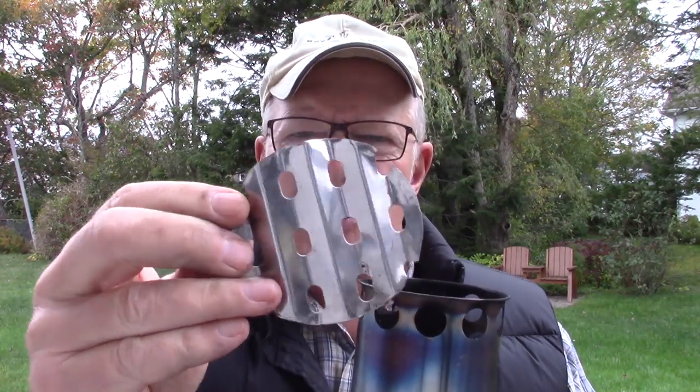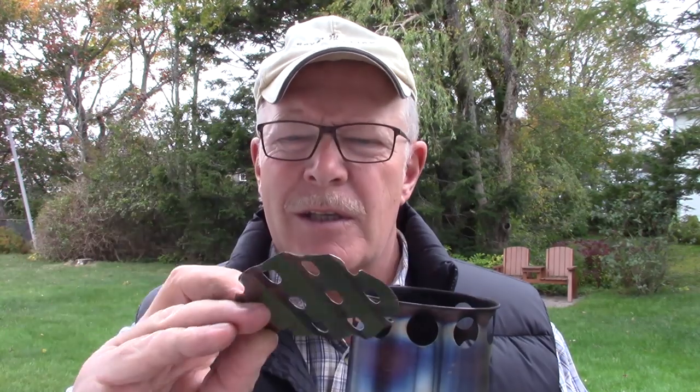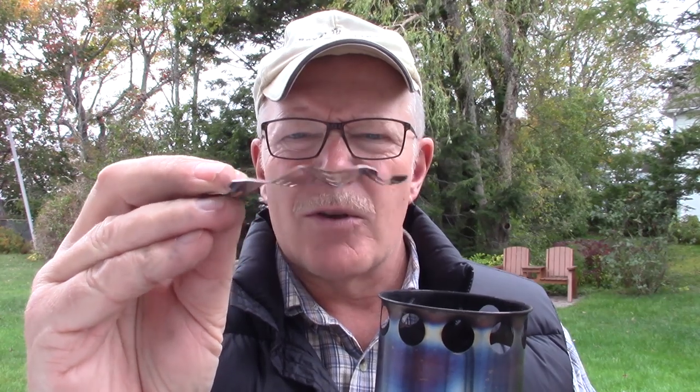What's different about this new plate is two things. One, the holes are smaller, so they should be small enough to keep the pellets from dropping through. But also it has a bit of a corrugated texture, so there will be airflow coming around the holes — hopefully just enough airflow for the wood pellets to burn, but not so much that the pellets fall through.